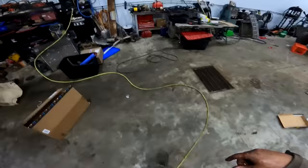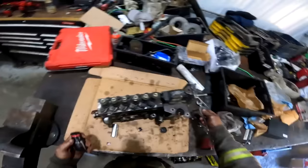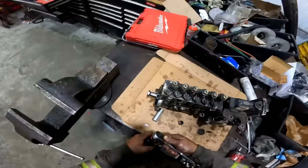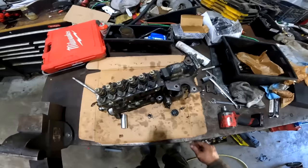Or just throw a pipe wrench right on the end of the shaft. They'll love that. Alrighty, now go ahead and grab a, what is that? A 1 3/16. I don't have any communist sockets that big, so just go ahead and bottom the hooter out. And now spin her over until you see your governor spring sitting there. Minty. So now what you do is change your governor springs.